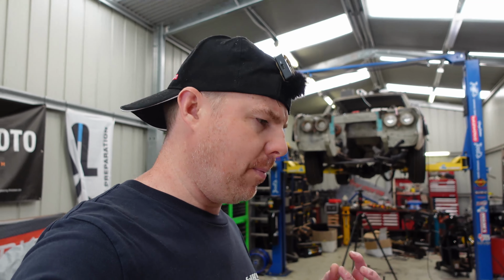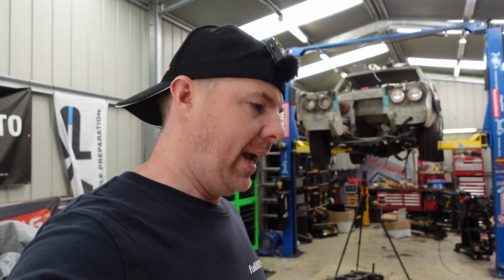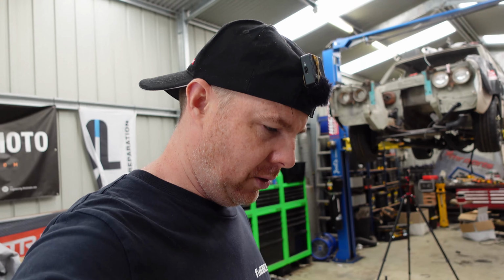Now, you might luck out and get engines that look killer, especially the gas engines. They keep the bearings looking pretty good because there's not a lot of contaminants in the oil, because gas burns really clean. However, it doesn't matter how clean an engine burns if the person that owns the car never does any maintenance at all. The color of the oil from this engine did not resemble what normal gas engines normally do, and the bearings really tell the story.